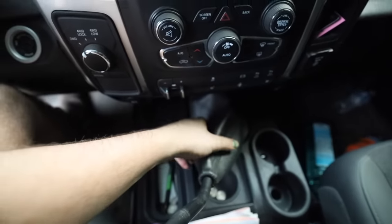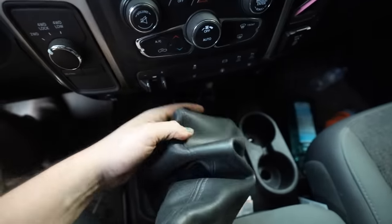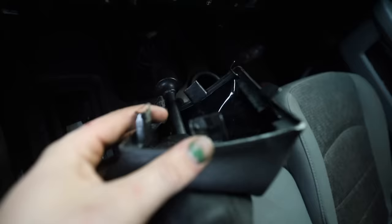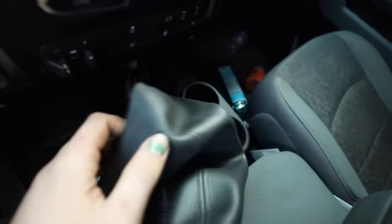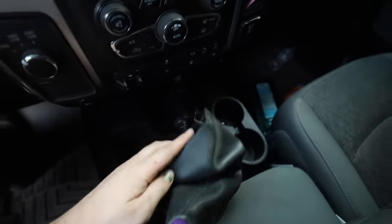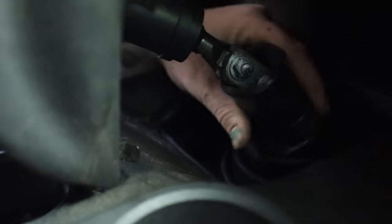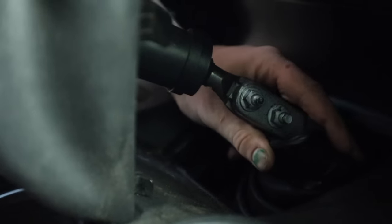Any trim package, really. What you're gonna do is pop it, it literally just pops up. Two sides are hooked in, and then the rest of them are kind of just these spring clips that hold it down. But you pop that off, and then down here on the floor, you pull this rubber shift boot back, the second one underneath this leather one, and there's two nuts right there. You loosen those two nuts and then the whole shifter will come off,